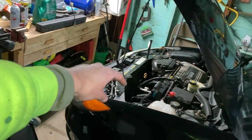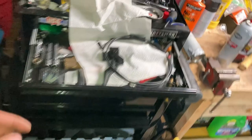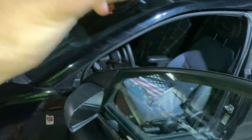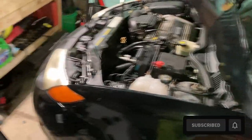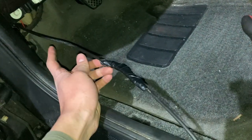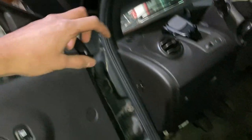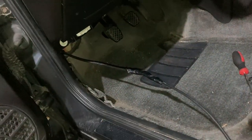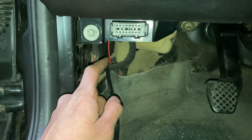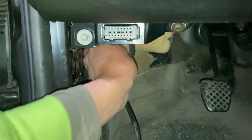Actually, I just got a better idea. Instead of pushing the new cable tied to the old cable, I'm thinking I should pull it from the other direction — the straight end has a smaller diameter so it'll be easier to pull. I'm going to cut the handle off, just use the bare cable, and snake the new cable through that way. I went ahead and connected the new cable to the old cable using electrical tape, nice and tight. The goal is to pull the cable from the engine bay, dragging the new cable in to replace it, so I don't have to deal with crazy snaking — because not only do you have plastic, you have sound dampening foam in there too.